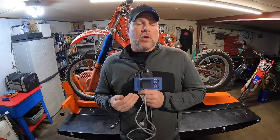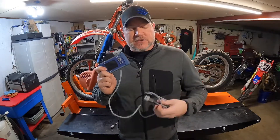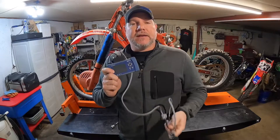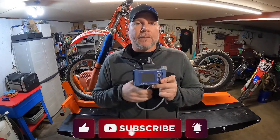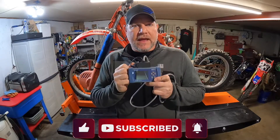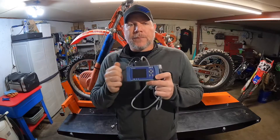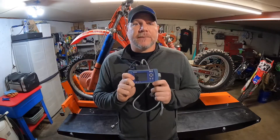That's a pretty big deal if you had an FI light come on and go off — it's no longer active so it's going to show a C00 up on your dash when you jump the Diag plug. This little guy is really nice and handy. It just plugs right into your Diag plug, and if you're going out to test, the other parts hook up to your battery so you can keep it running and use the little data card on the side to data stream all your information. If you're just checking codes, you can bypass the VIN number stuff and check all other parameters.